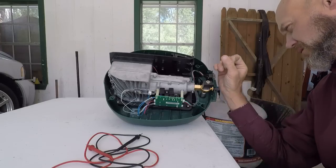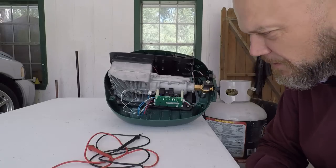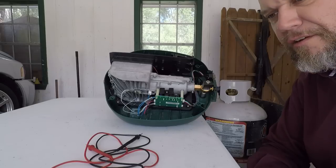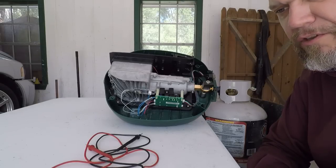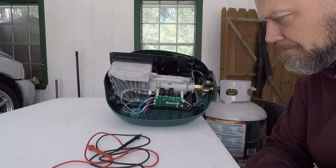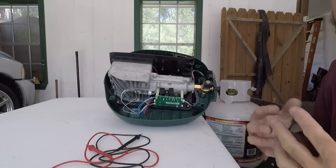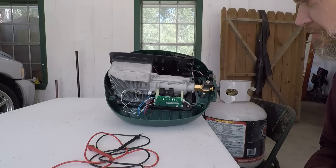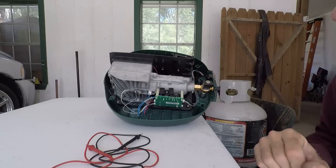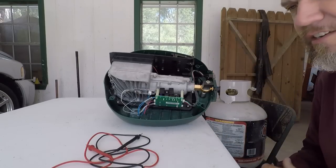She's running, she's not blinking. I'm pretty happy with this because this thing wasn't cheap and it does seem to help. I don't have empirical evidence other than when I'm sitting outside there are fewer mosquitoes - and there seem to be more mosquitoes over the last several weeks that I've been trying to get it started. So I hope that's helped you all. If you have a problematic Mosquito Magnet, rather than throwing it out pull your four body screws, give this thing a clean, and put it back together and see if it'll work.